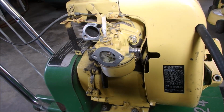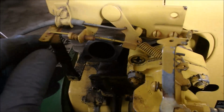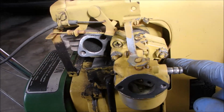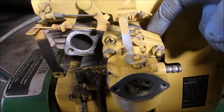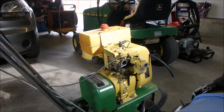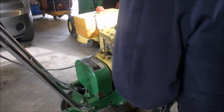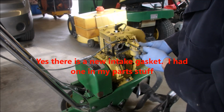Okay tubes, now I am installing the carburetor back with the linkage the way it was. And I'm glad I took a picture of it. And I'm just tightening up these two Phillips bolts last, because these bolts that come through this way have to be tightened up from the back here. So let's just put you on the perch so you can see what's going on. And away we go. First I'm going to use smaller screwdrivers, and then we use the bigger one to torque it down. And I don't use gasket glue on any of this stuff.